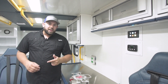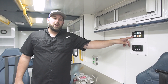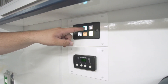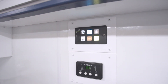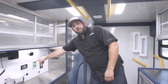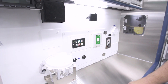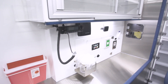With the AceTech electrical system, you'll notice different button panels or switch panels than the traditional rocker switches we're known for. We have a six-position switch panel here — lock and unlock, interior lights, ventilation fan, scene lighting, load lighting, and the air conditioner controls are mounted here. If you swing over to the action wall, there's an identical switch panel replicated over there so you can control everything from either place. Also at the action wall is your vehicle-mounted suction, USB power, the customer's radio assembly, and access to the main regulator for the main bottle.